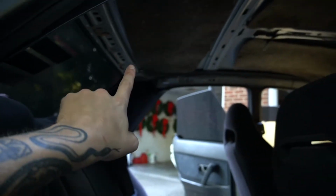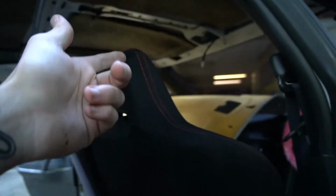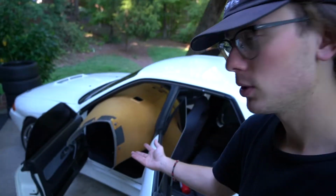All right, so after I've done all the screws on the handles and the lights, I literally just took a screwdriver and ran it around the outside of the headliner, and all my trim pieces, all the pillars popped off super easily. I don't know what we're using nowadays, but dude, these clips work flawlessly. So anyways, now we're using the hot dog method, and we're just gonna pull it out of here.